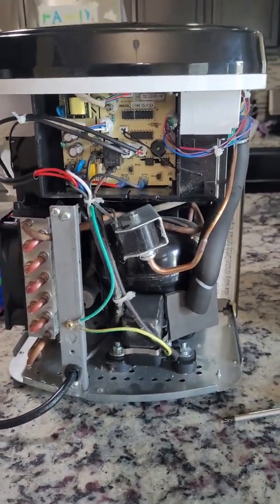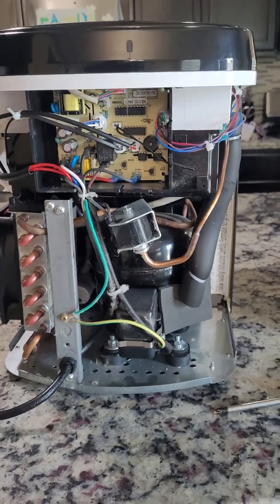you will be to the level where the components are. What's going on is you have an infrared sensor that is emitting infrared light, and this is picking that light up and letting it know that it's okay to go ahead and fill the bin. If it can't see the light, it assumes that there is ice blocking it.